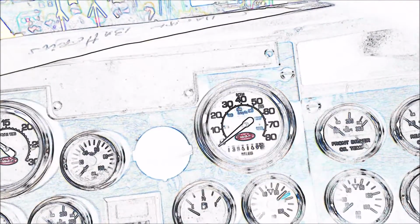Like I said, we're looking for about a 5 to 10 PSI window with this particular test with the parking brakes on. And right now it's dropped to about, oh man, it's dropped to about 100 already on us. She's sinking fast. Let's hope for the 90. Let's hope she doesn't go past 90, ladies and gents. If she goes past 90, man, it's in critical condition.